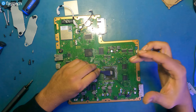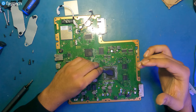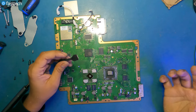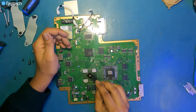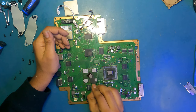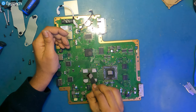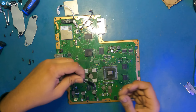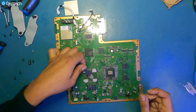I mean, you can remove the lid, but that creates problems because you don't want air bubbles in your thermal paste. A lot of people apply it that way, and then lift it up like an idiot, and then you're not gonna do any real damage, but you're definitely gonna take away from the cooling ability of the paste if you stick the IHS back on and then remove it. So I'm just simply spreading the paste with our applicator. A little bit went off the edge there, no problem. We'll get to that later.